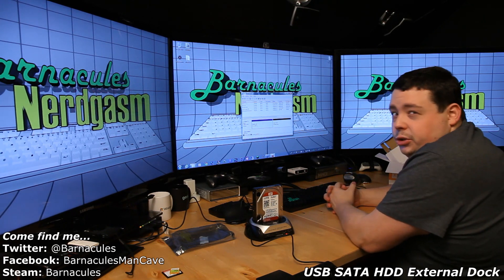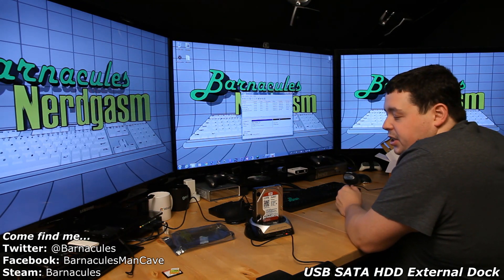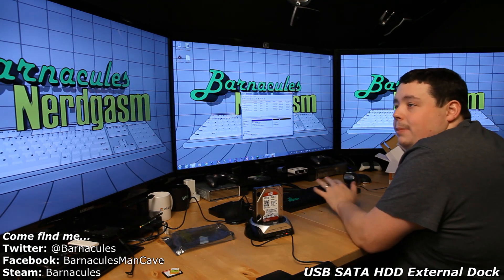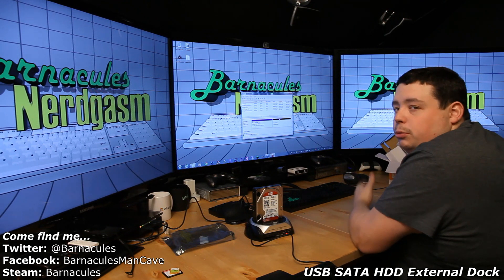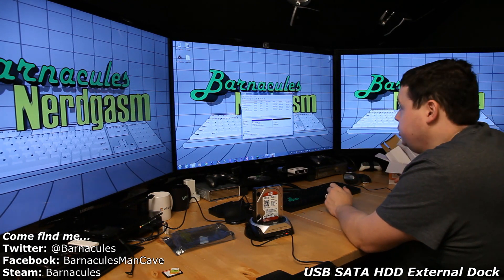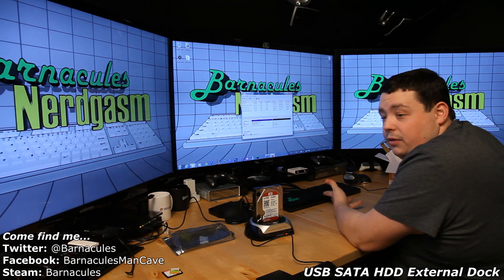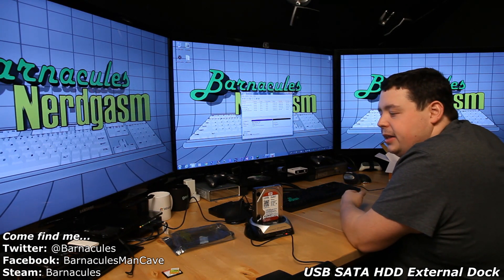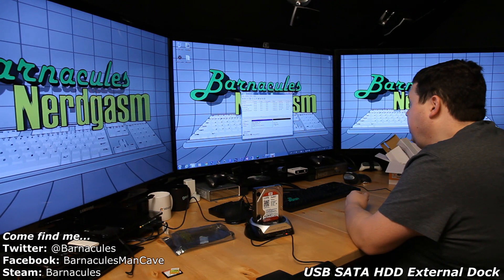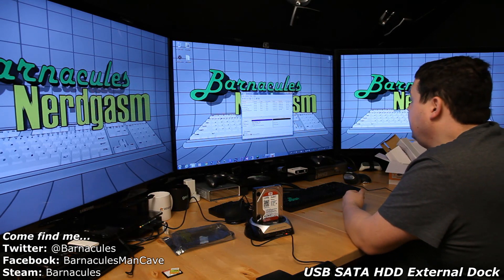If the drive is new you can go ahead and do a quick format — it's much faster. It's already done formatting and I have a new 2-terabyte volume. But if you have a disk that already has data on it and you want to ensure the data is destroyed, do a long format. Instead of just wiping the file allocation table, it goes and overwrites every single bit on the hard drive, which finds bad sectors and ensures data destruction. Though that doesn't mean data is unrecoverable by the right people — for that you need a low-level format, which overwrites each sector so many times that the underlying data is completely unrecoverable.